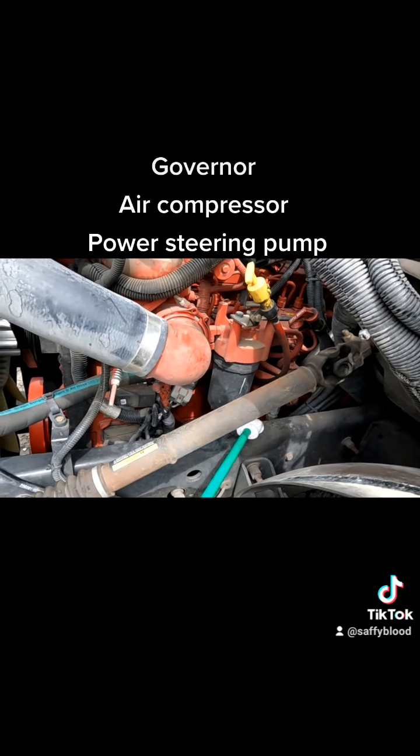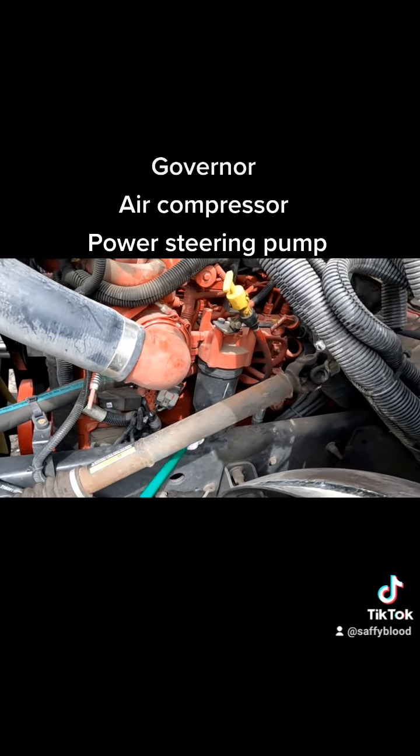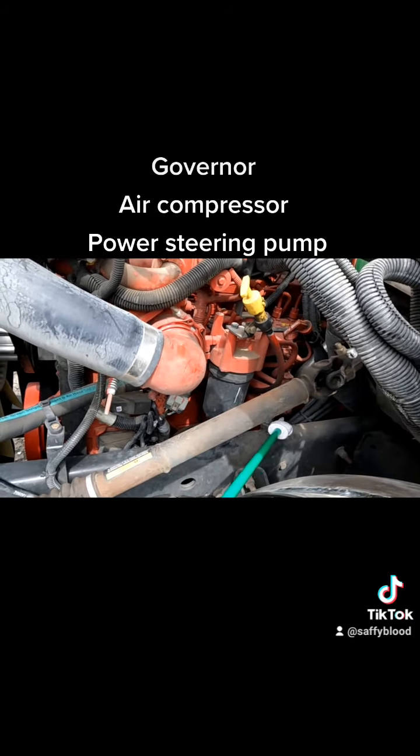We're making sure they're securely mounted with all bolts present and tight, and that all the hoses and lines are secure with the fittings in good condition. These are gear-driven items, and we're making sure there are no leaks, which should be indicated by hissing. We're checking our steering arm, making sure it is securely mounted with no cracks, bends, welds, or aftermarket modifications.